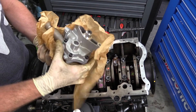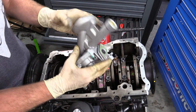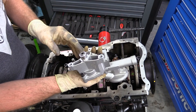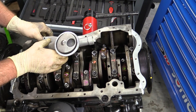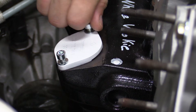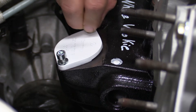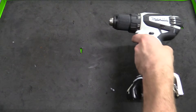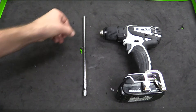We're going to be doing this oil pump prime on the VR6, though the techniques can apply to many other cars. The method might be a little bit different. Either way, you want to take the steps to prime the oil pump and get oil through as much of the engine as you can before that first startup. The tools we're going to need are those required to get access to the pump drive, and a drill — not an impact. It's really important. We don't want the hit of an impact; we simply want to spin the oil pump.